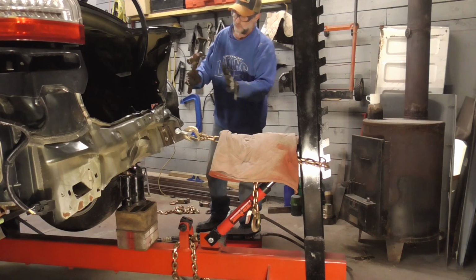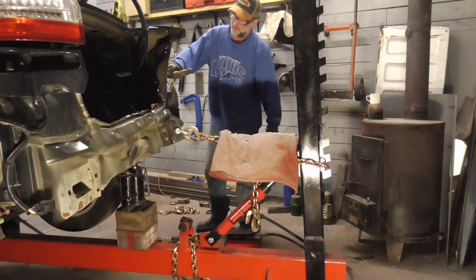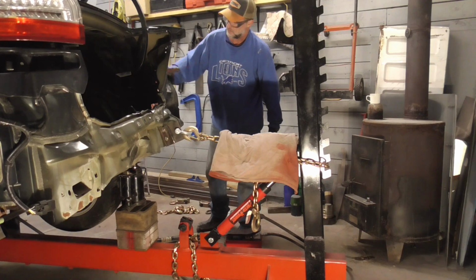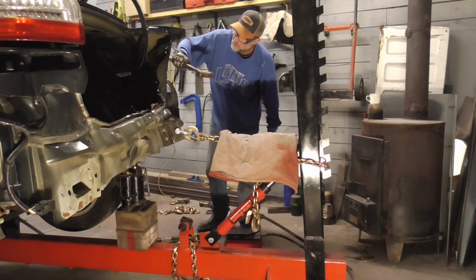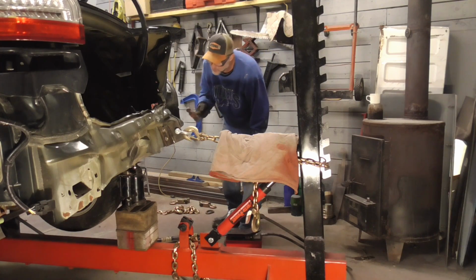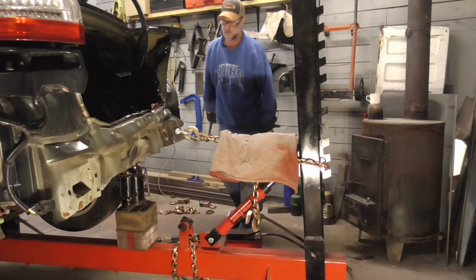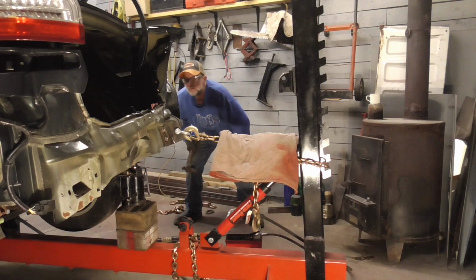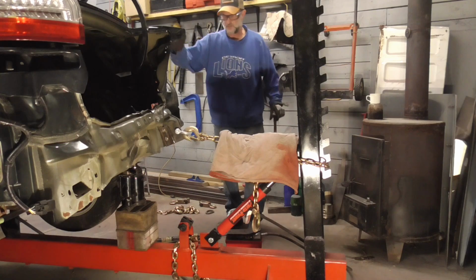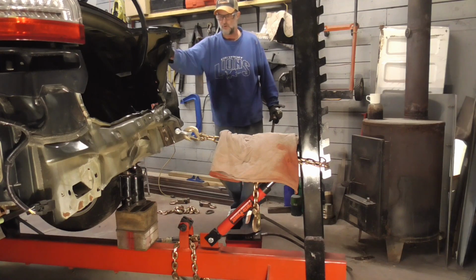And I'm just hitting some crowns right now, parts that became a crown in the accident, and if you hit on those, you can see the dent sort of walk right out. And we do have a little ways to go. I might pull a little bit more down and on an angle on the next pull, but we'll go a little bit more here.